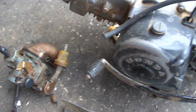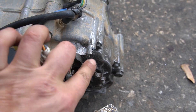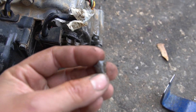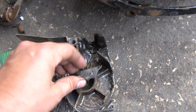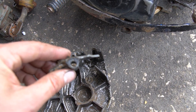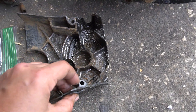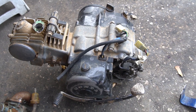Got the carb with it and the manifold, but I'll be swapping that out. As far as the extent of any damage — that casting right here with the cover that covers the chain output shaft — it's a clean break, so I'm gonna weld that and you'll probably never see it again once it gets smoothed out. The cover also took some damage but it's a clean break too, so it can get welded back up. It's cast aluminum. Unfortunately some things got broken, but very minor — could have been worse, so I'm happy.